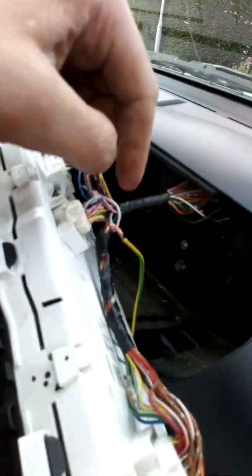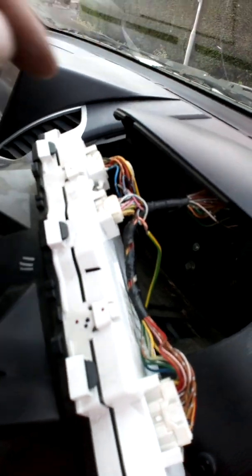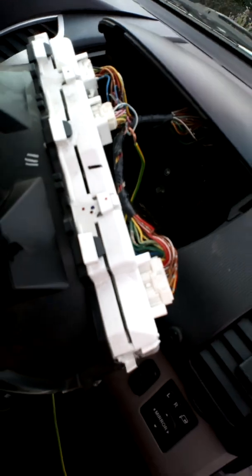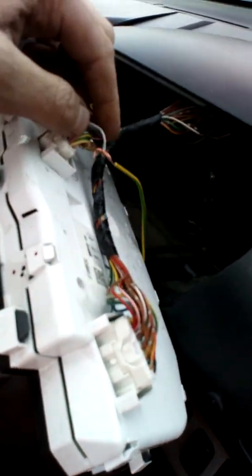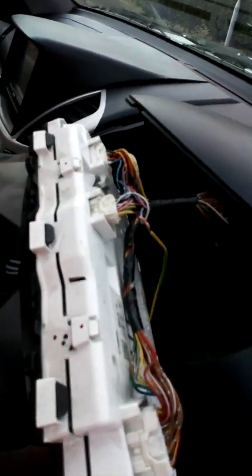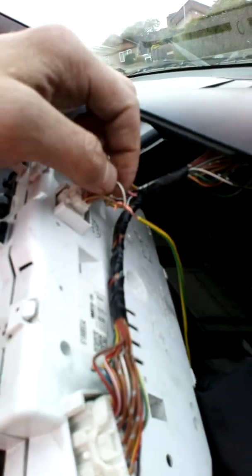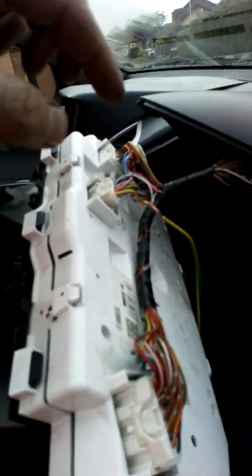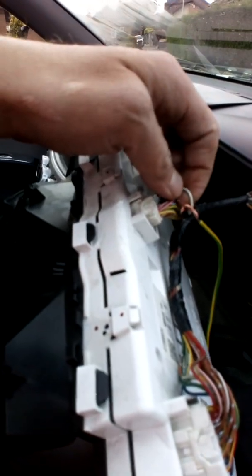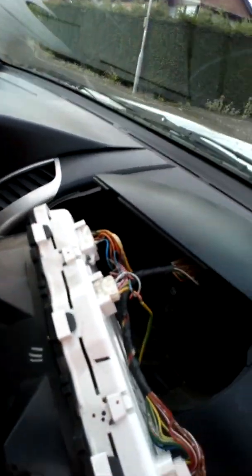Now it's a case of getting some black wire and routing it neatly with the existing cables. I'm just going to run a new cable into the dash and that's this problem solved. I just thought I'd give somebody a heads up if your speedo stops working — give that a try. Pull the casing back, put a new wire on, trap it in the door, go for a little drive. It must be a common issue — the harness must rub somewhere. I hope it helps somebody out. Cheers.